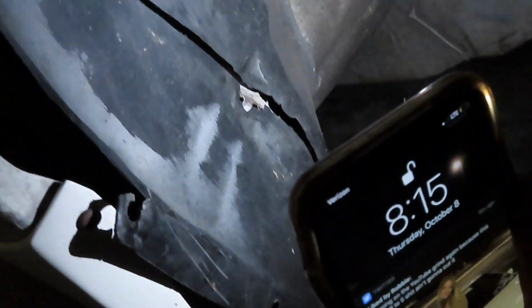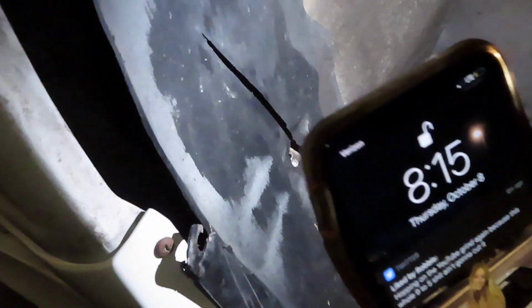You guys have seen my weird tire wear. I'll show you guys again if you don't remember. Like that, and it is not like that in the rear, even with matching camber. And what I found is there's this little pinch weld thing behind this. Yeah, that thing. That's very sharp, and it's cut through here from rubbing something. And I'm assuming it's not just from driving straight. It's got to be from full lock one way or the other, or I guess full lock to the left. So I'm definitely gonna keep an eye out on that.